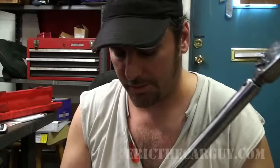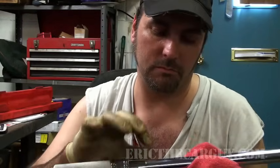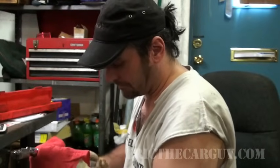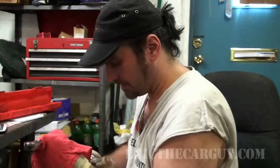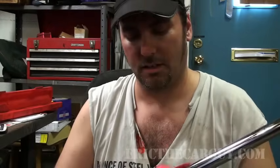Voila. One more thing I would like to add about these torque wrenches is that you never want to store them with a reading on them. You always want to store them at 0. So when you're done using them, bring them back to 0. And actually, this torque wrench is about 12 years old. I like to keep it clean. It's one of my favorite tools.